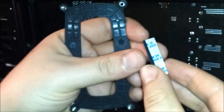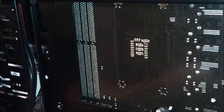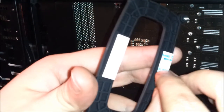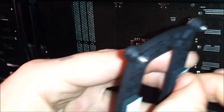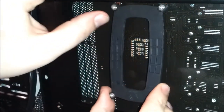Here's your back plate, which goes on the back of the motherboard, and that's what your screws and your block mount is actually going to screw into. Because this is a whole new socket retaining system now, versus the old AM3 Plus with the clamps where you put the clamps on and then tighten the lever for the stock heat sink. This completely converts that to this new system, and this back plate just goes on as simple.